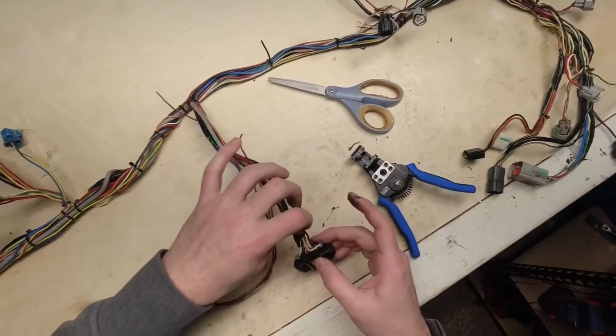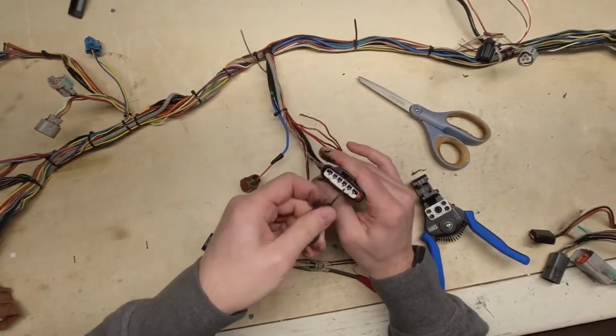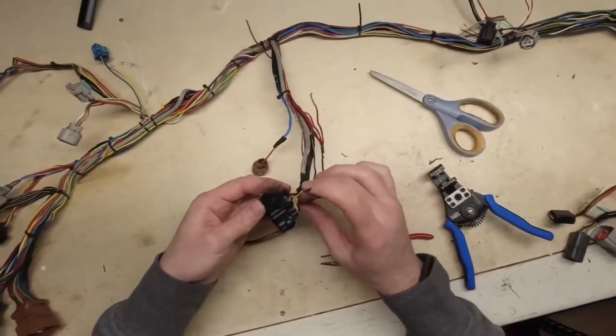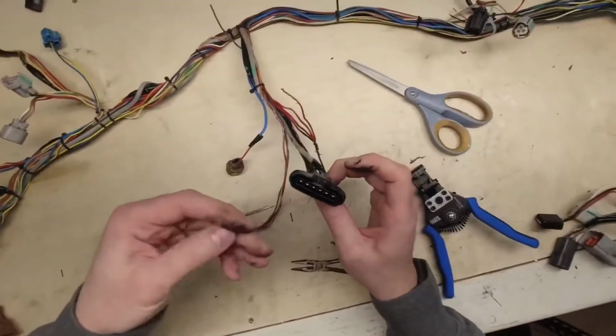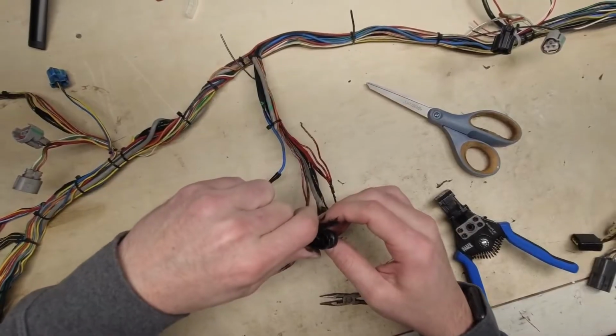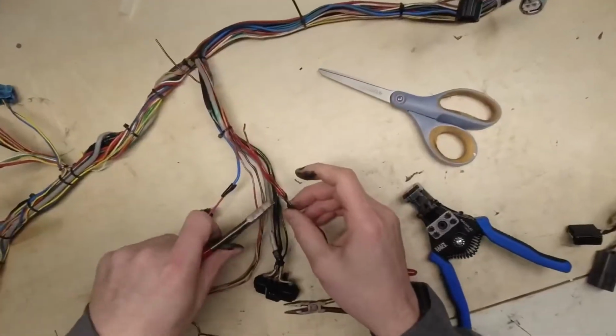what we're going to do is actually de-pin this power wire. It's an easy one. Pull that out. See you later. Then we'll de-pin sensor power here for the throttle position. It would appear its lock is generally the same as the others. It is. Let's cut these wires off.